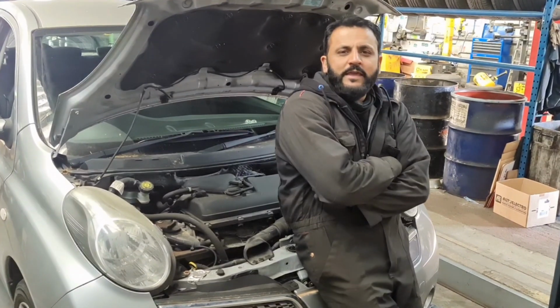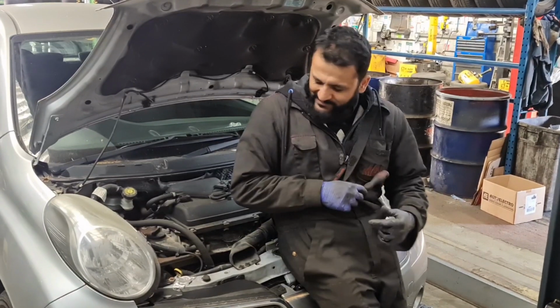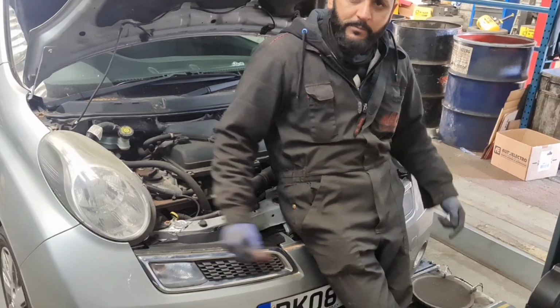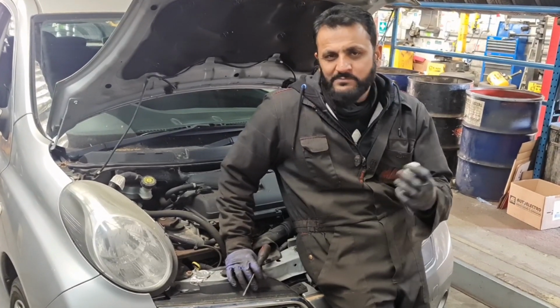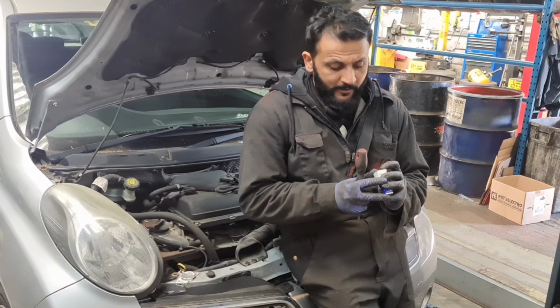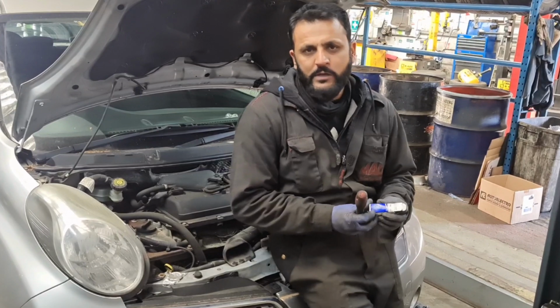From Taj Motor Medics. I've got a Nissan Micra here on a 2008 plate, just doing an indicator bulb on this. Basically, it's this one and this one here. I'm going to replace both of them because the color of it, instead of being orange, is slightly white now. It's just basically discolored. The bulb you need is a 581S, which can be found in the description as well. So if you click the link, you know where to get them from.